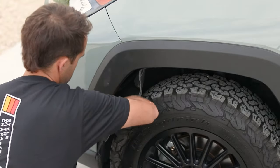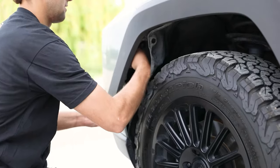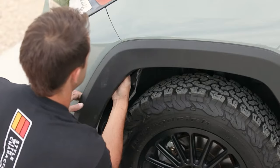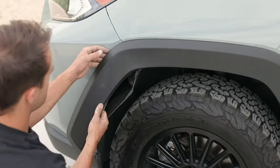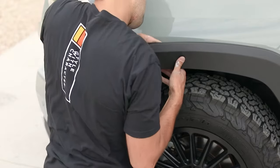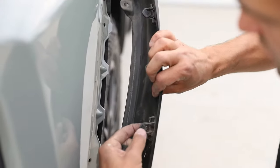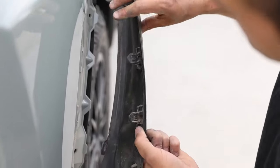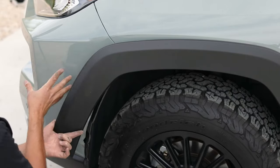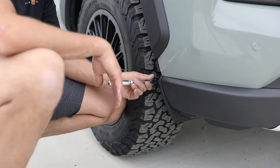First one's right down here. And as you pressure those, you can just pull it away just like so to about right here, and then this is where your first clip is, and then one more just like that. So these are the ones that you'll pinch and press out. So you get four of them, and you get the two clips at the top that it removes and releases this whole section of the bumper. Now let's go do the same thing to the other side.